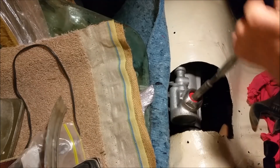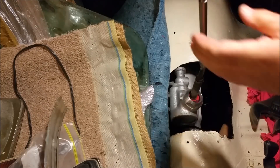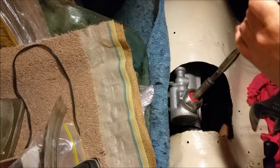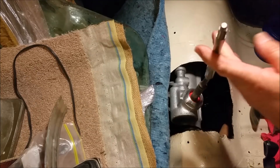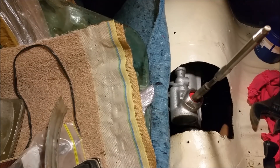Put on the clutch. Fourth — and that's reverse, you can hear reverse — first, second, third, fourth. Lovely. Alright, so let's put this spring on, because at the moment that's going straight to neutral and straight into reverse. So let's see if we can fix that up.